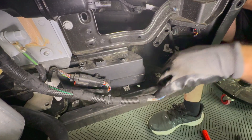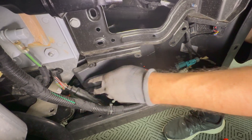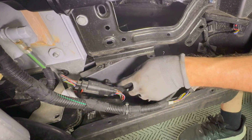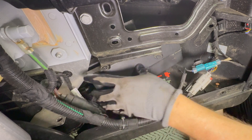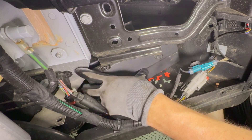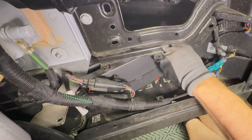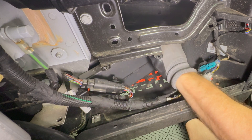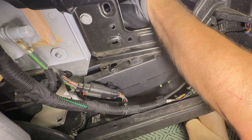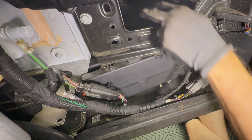I've loosened and removed four bolts. I'm going to take a look at the speaker. There's a connector in the lower corner here. Due to the shape of the bracket you can't just pull this out straight, so I'm going to try to bend this around to see if I can access it. There are actually two bolts back here for this bracket as well.